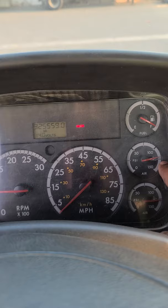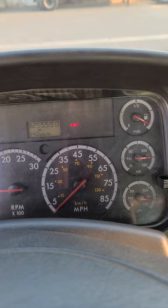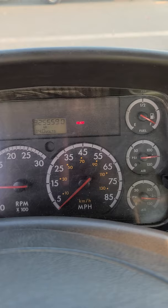If you want to accelerate the process, press the fuel pedal; if not, just watch the needle — it's close to the middle lane. This is 125 psi. After you hear the governor cut out, wait about five or six seconds and then say: 'This is a good test, my governor cut-out at 125 psi.'